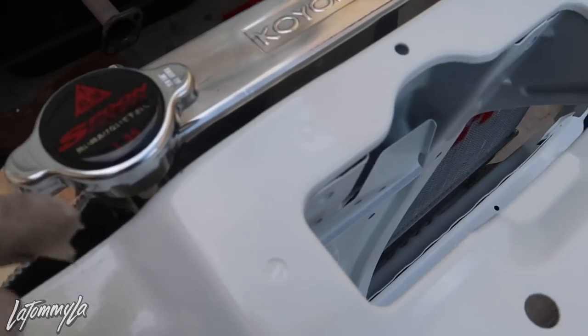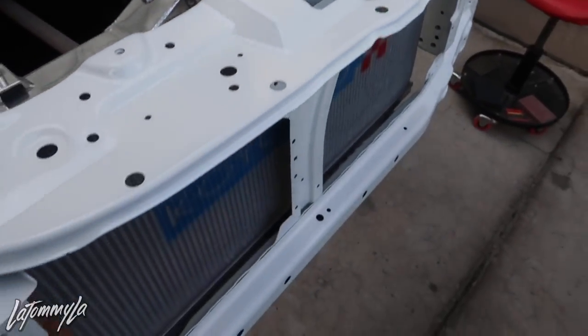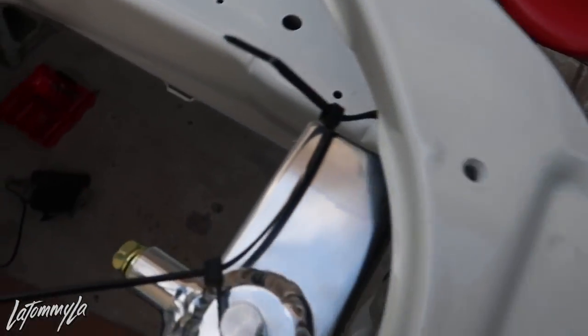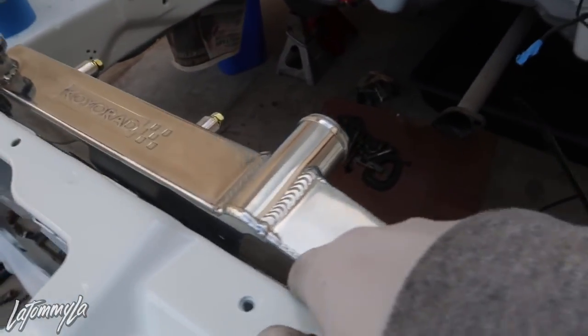This is how far I'm gonna make it sit, so I just need to get some custom brackets. Currently I just have zip ties on it to hold it in place. I decided to flip the bracket and use the ASR bushings with the brackets on top because before I was having an issue where it was hitting the frame — the frame is bent a little bit from where you jack up the car — but now everything else is sitting flush.